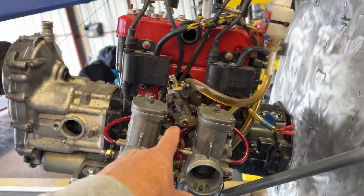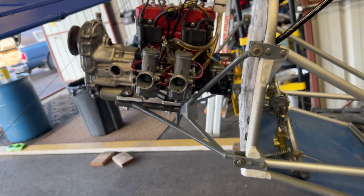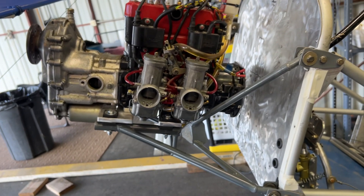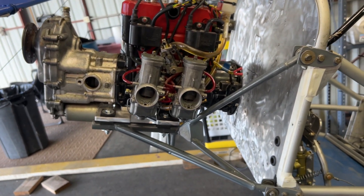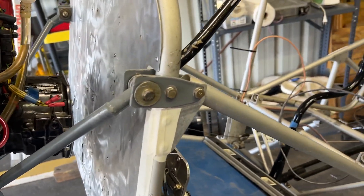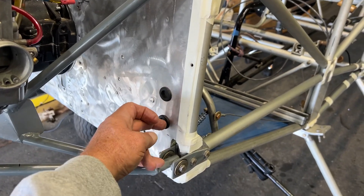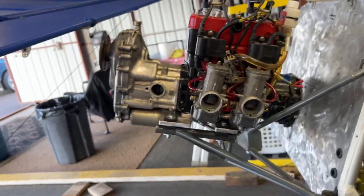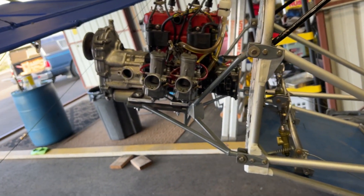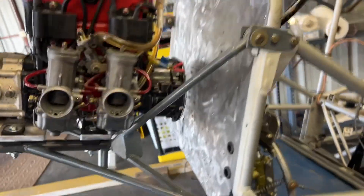I've decided that I will take the pump off, blank it all off, and run straight mix fuel. It's just going to be too big of a hassle — too much stuff behind the firewall. So I'll use these two holes here: one of them will be for the throttle cable and the other one will be my primer run for the carbs for start. Then I'll probably run some power through there if needed, and I've got another grommet on the other side for that.